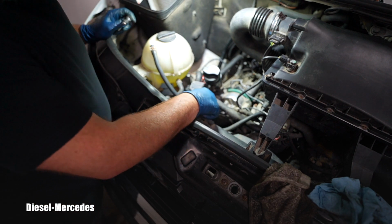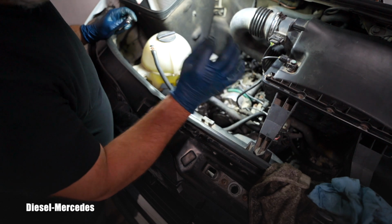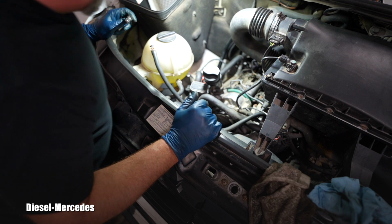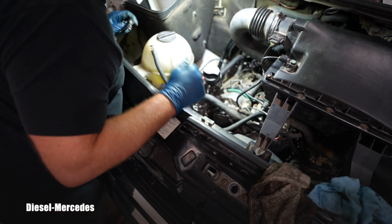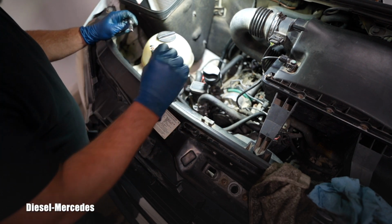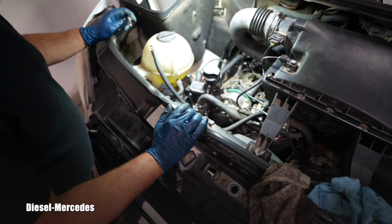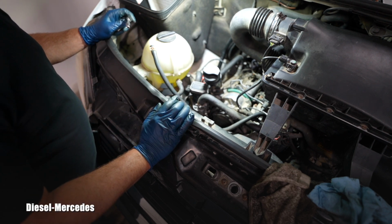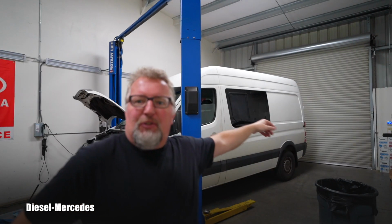The amount of coolant which was lost here was so minimal. I guarantee you, you don't need to worry about the level in this cooling expansion tank. There's no way. It was just a tiny bit of coolant which was spilled here because I clamped that. So that's definitely not an issue and nobody needs to worry about that. My last thing right now will be to open the shop, start the engine, leave the exhaust out, and I will check if I don't have any coolant leaks or if everything is working perfectly.